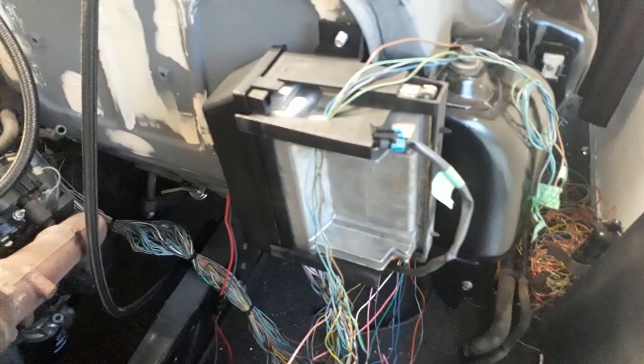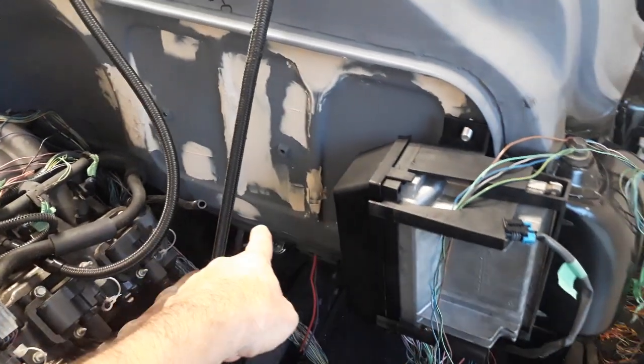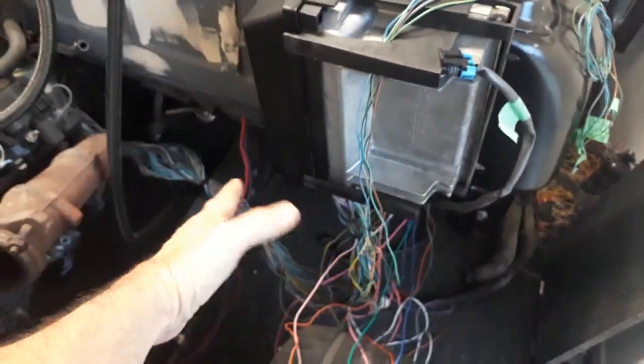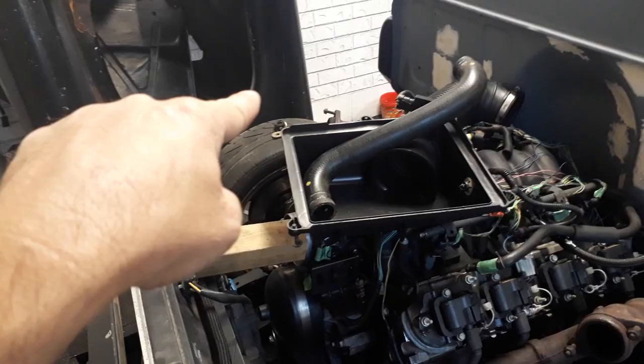Brackets for my aircon are done — I covered that in the last video. Brackets for the radiator are still coming. At the moment, the ECU is just sitting on the dash on the bonnet hinge. The wiring comes out from behind the engine, runs along above the brake pedal and steering column into the inner panel. It's going to mount on the inner panel with a cover over it. The water bottle will sit up here, and the battery box will be on the other side with the master fuse, relays, and circuit breakers for the fans.